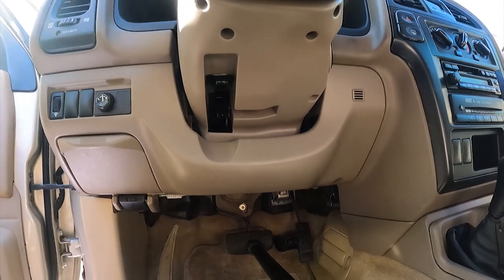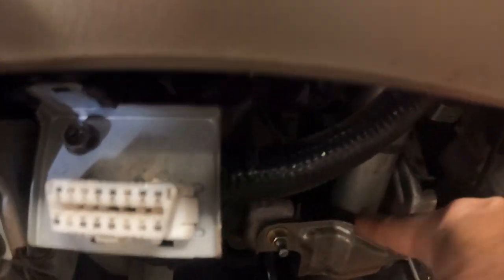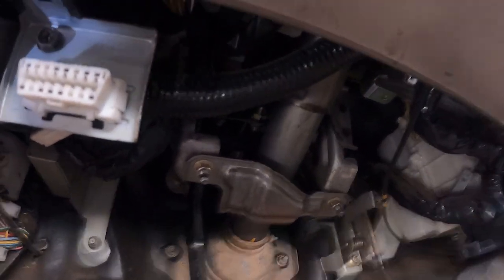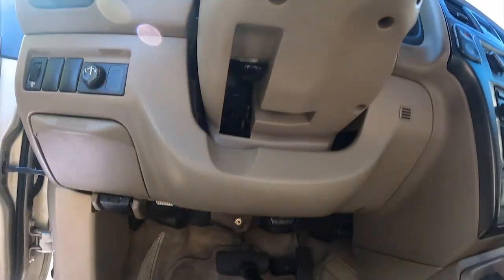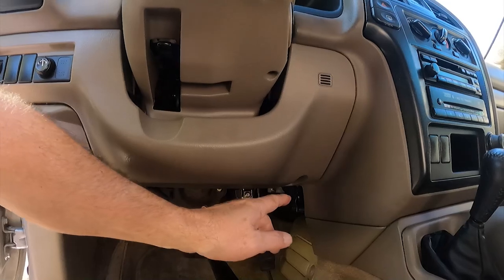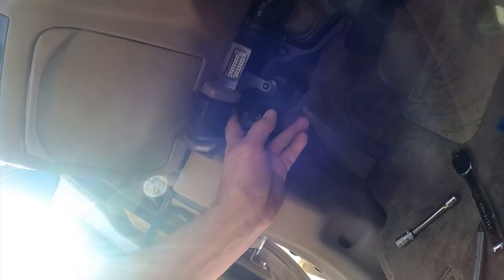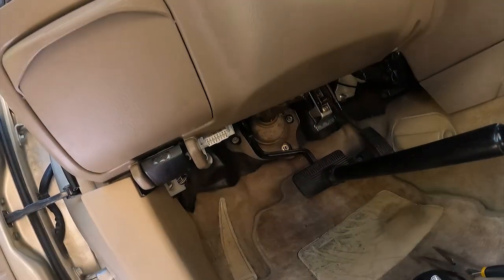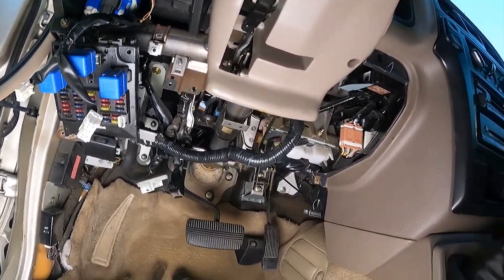After trying to get those in there, we just don't have enough space. This particular plate that you would think would be obvious to take off is actually spot welded on the back to the column housing, so you'd have to pull that all the way out to get the plate out of there. So what we're going to do to get a little more room is pop this panel off. There are screws down here, up here, and a couple more — and once you get this off, there's a screw back here that needs to come off too, then you can start getting this panel off. After trying a variety of different things, we realized we had to take more of the dash apart than we thought we would to be able to get in there.